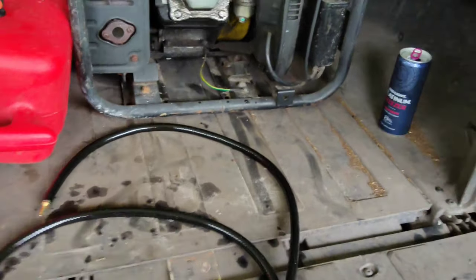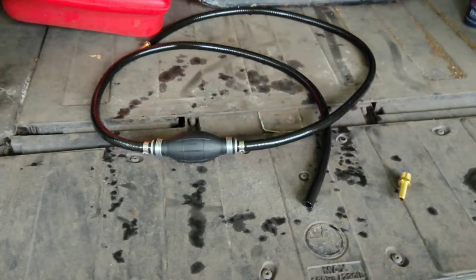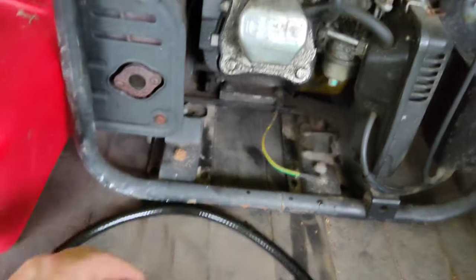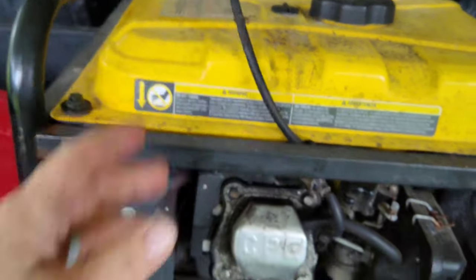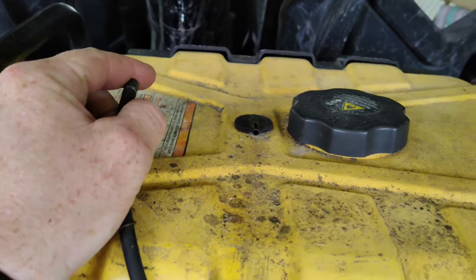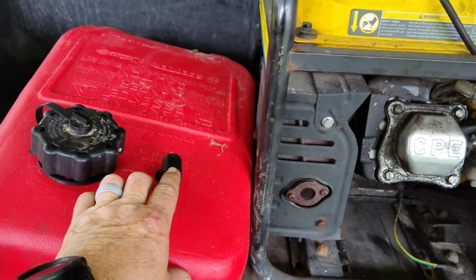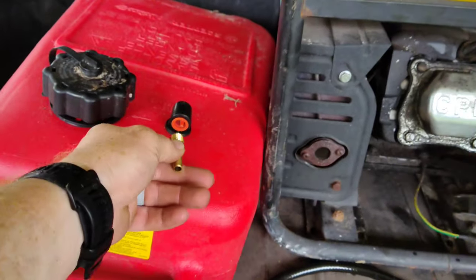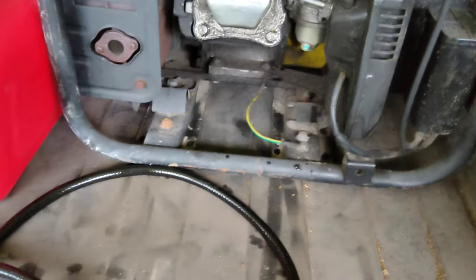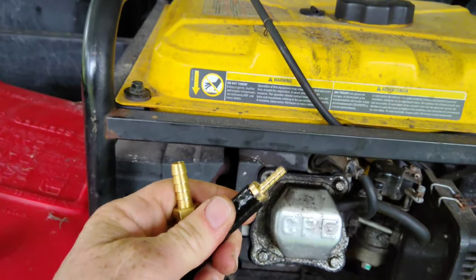How I plan on doing it: I bought this regular fuel line, a self-prime line for boats and such, that would hook up to it. And then I have this line right here. I believe it's 3/16ths, and that goes into the vent — the vent line is 3/16ths as well. I bought the piece for it, so this will slide in there, and this end right here should slide into the other end of the hose.